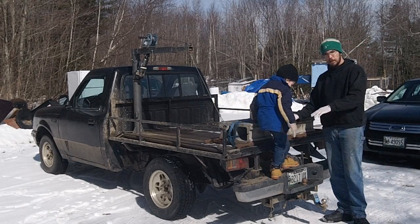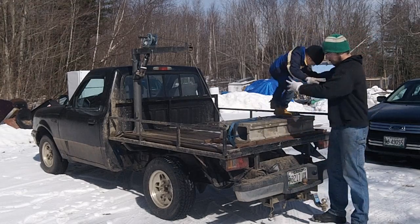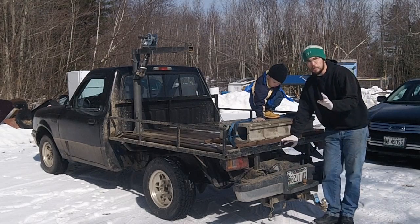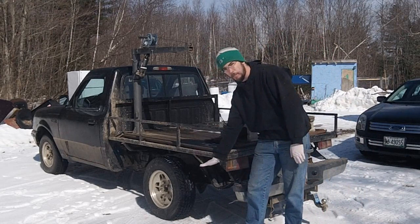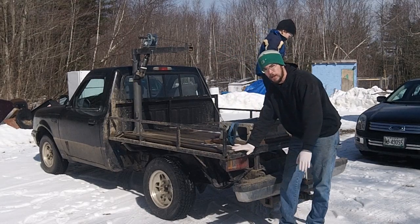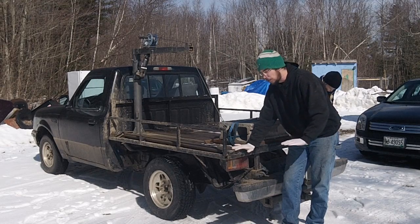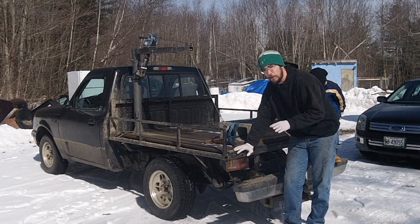On a regular Ford Ranger, your bed height would be down lower. The reason this flatbed is so high — as I explain in my original video — is to provide clearance for the tires when they're all the way bottomed out. The problem with that is I have to use extended ramps when I want to load a lawn tractor or anything else. My ramps have to be a good two feet longer. I actually use eight-foot boards for my ramps and I still end up with issues trying to clear a really low mowing deck. That's been another learning experience.